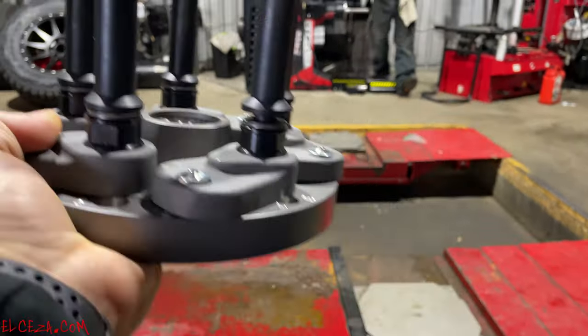Make sense? Okay? Cleanliness. Y'all are pretty good about it out here. These balancers have three legs. They've got one here, excuse me, one here, and one here. On the bottom, obviously. Then there's a kickstand on the backside. That kickstand is not on the floor. It is about a quarter of an inch off the floor. Do not help me and loosen the bolts and put that kickstand on the floor. It is not supposed to touch the floor. That makes a poor contact point, and we don't need four.